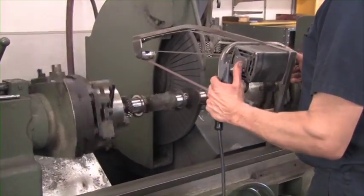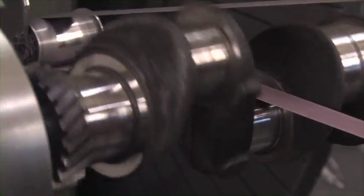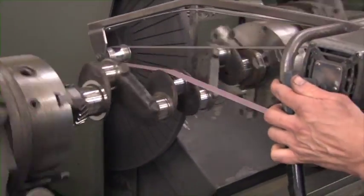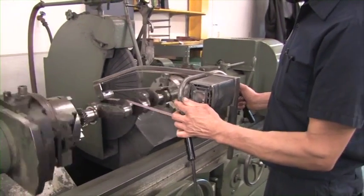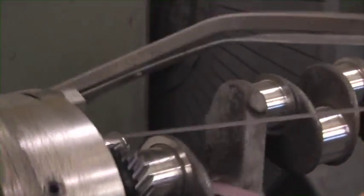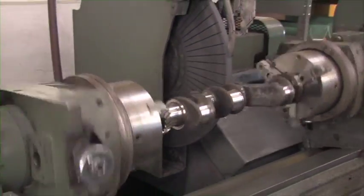Bearings are ordered to facilitate the size of the shaft. As an example, if 10 thousandths of material was removed from the shaft, we purchase 10 thousandths undersized bearings. Bearings are commonly available in sizes like 10 thousandths under through 40 thousandths under to accommodate how the shaft was ground. This assures the engine of smooth running and proper oil clearances.